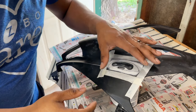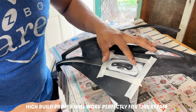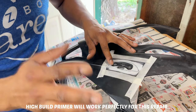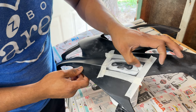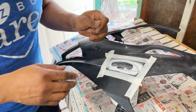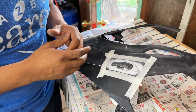I've sanded this again — I have tape so I don't go too far — and now it's smooth to the touch. I don't even think we're going to need Bondo for this; everything is smooth with no grooves. This is one of the best repairs I've ever done. You shouldn't be able to feel any grooves — if your nail catches on something, it will show through the paint. So I'm going to hit this with some high-build primer, sand it one more time, and we should be ready for base coats.